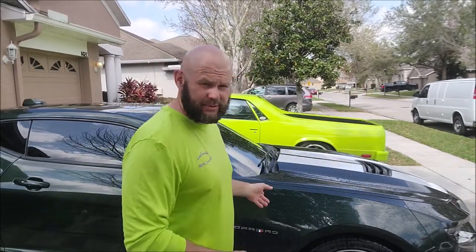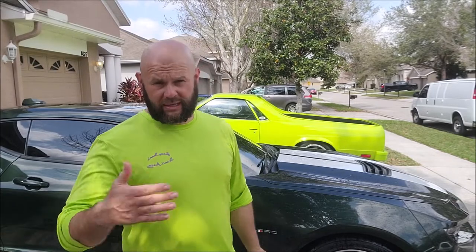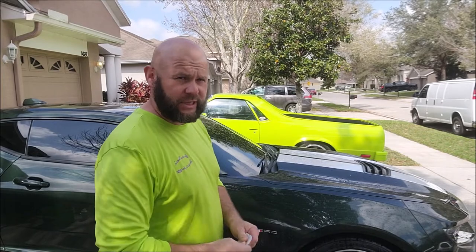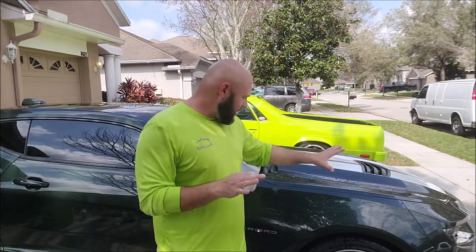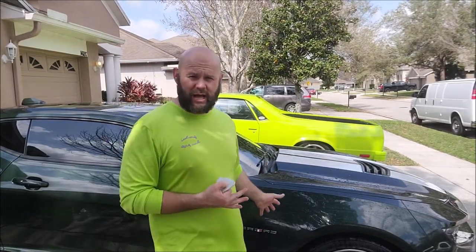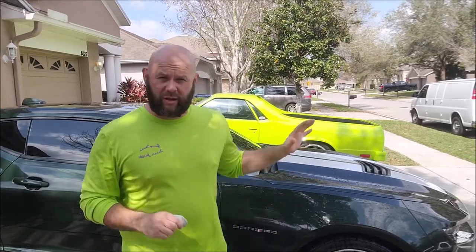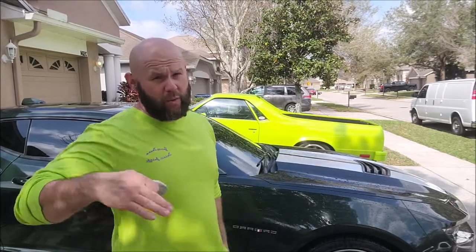That's for cars that are not heavily contaminated and for vehicles where you don't visibly see rust chunks. A lot of times on darker paints like this you won't see them — it'll be a white or silver car where you'll see those chunks. That's one option, the more traditional option: spray a lube on and use your clay bar. Now if you've got heavy particles you can see or even feel on the paint, or if you've done this and can still feel it really rough, you might want to step it up.